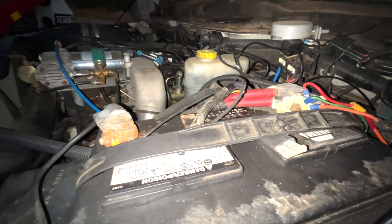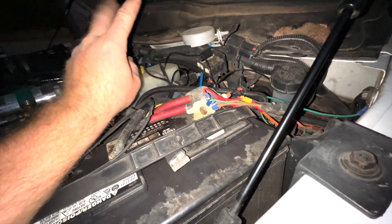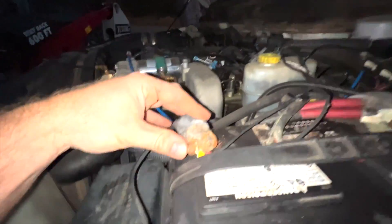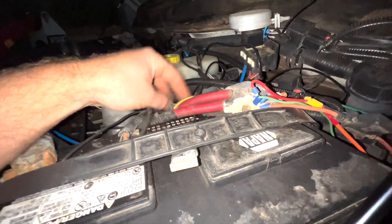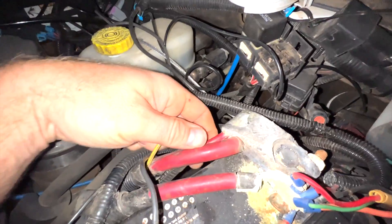Alright, just hauled some equipment tonight. Let's go move this truck, roll up the window so animals don't go in there. I just wanted a quick diagnosis but I was thinking I might stumble across something and you guys want to be involved with it. That stuff there is for the pack brake, that's for the FAST. I was about 22 years old when I bought this truck. What I'm thinking could be the issue — because the last time it did this it snapped out of it quick — I went through and cleaned all these terminals. Battery terminal corrosion has come back. Checked it on this side, you got body grounds, you check all those. But this is what I was just looking at.